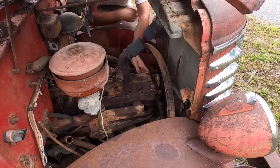I got all this stuff already set up. Going to hook the battery up, then spin it over a few times — hopefully the starter doesn't get stuck, because last time about two days ago the starter got stuck and it took me forever to get it free. I had to wiggle it back and forth and tap on the starter until it finally gave up. I also grounded the condenser out, just ran a jumper cable to it to make sure nothing is left to chance. When I was spinning it over the other day, there was so much white smoke coming out of the oil fill neck it was just outrageous. Going to pour some gas in here — a healthy amount — and hopefully not set the world on fire because there's a whole bunch of oil underneath it.